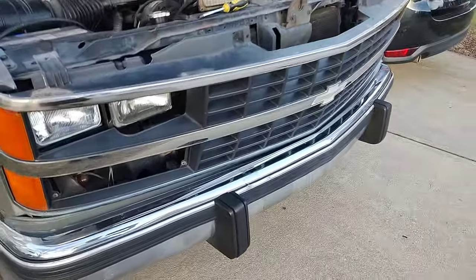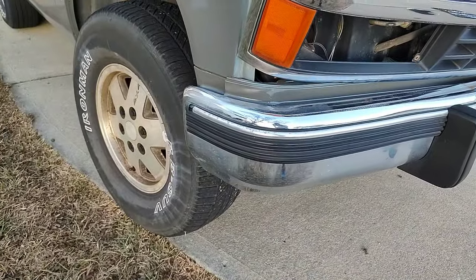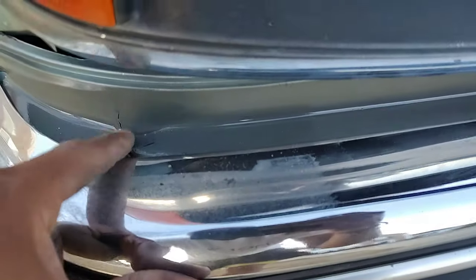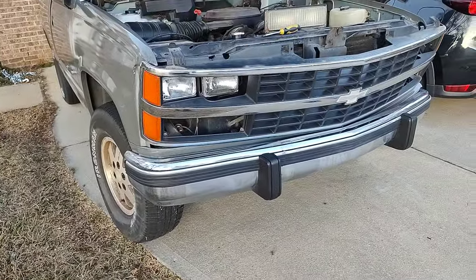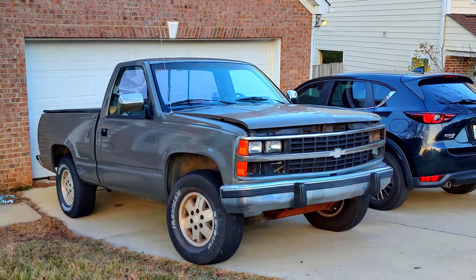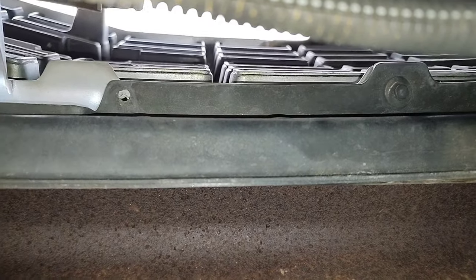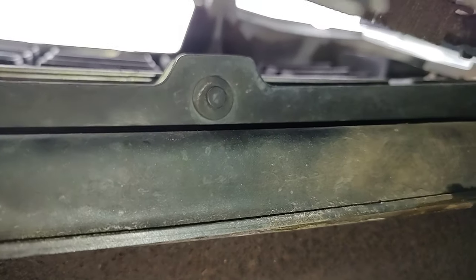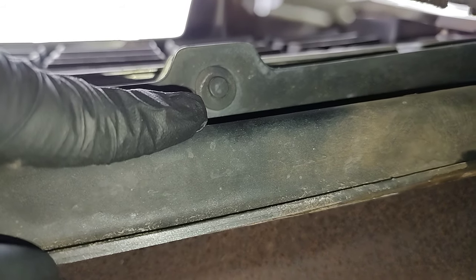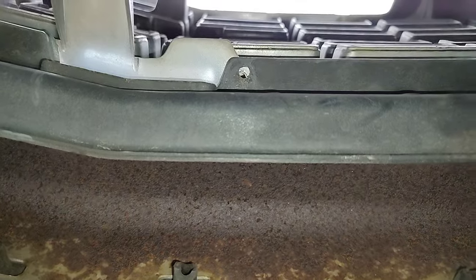I almost got the grill out, but apparently there has been some trauma to my passenger side front that has pushed the bumper back and it's keeping this area from coming out, so I may have to disconnect some fasteners. It's the next day and I'm under the truck looking up at the bumper - that is the bottom side of the grill. I won't have to take off the bumper if I can remove the fasteners holding the top part of the grill to the lower part. I think if I can do that I can take the grill off and continue with the headlight work.